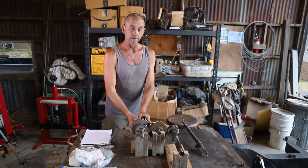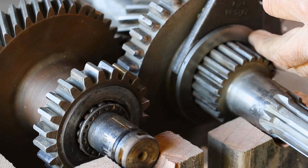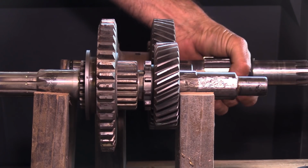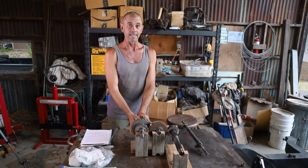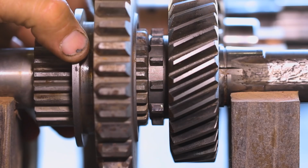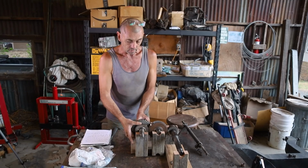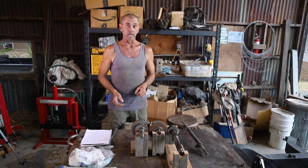Now low range has three settings and two ways that it can drive the shaft. Driven by our selector fork from the neutral position, position 1, we go backwards where it hooks in to a small cog that drives the large cog. And now, as you take your foot off the clutch, you are going to be in low range. We stop, and then using our selector fork, we drive forward into neutral position and then into high range, which is the second way this can drive the shaft. As it locks into those dog teeth, now high range no longer free spins, and it is able to drive the shaft in the high range ratio.